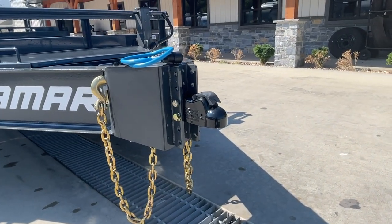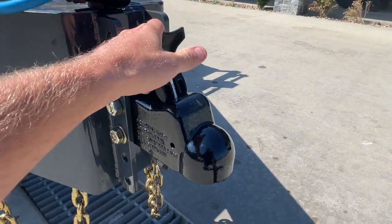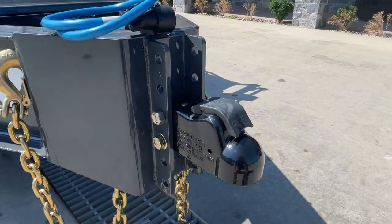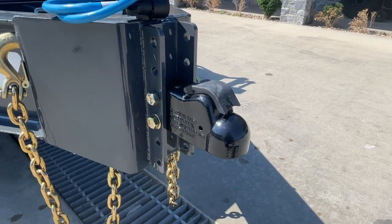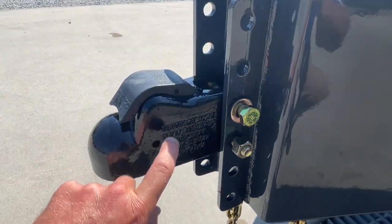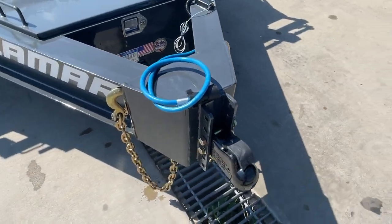Front couplers are boxed and plated a little bit different than some. You've got the Demco easy latch couplers. If you're not familiar with them, you leave it open and as you crank it down it's going to automatically close down. It's also a cast coupler. A lot of times these are only rated for 14,000 — these are actually rated to 21,000. It's one of the few two bolt cast couplers rated for that, so it actually works on the triple axle setup.